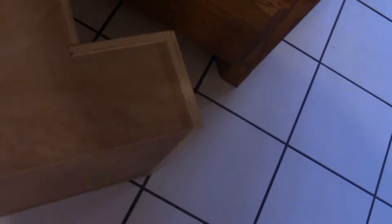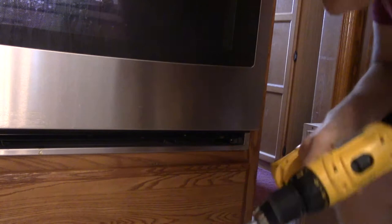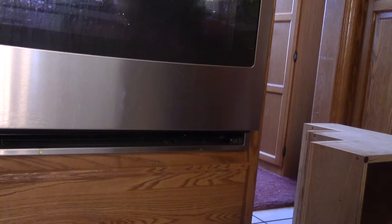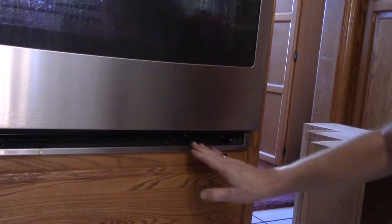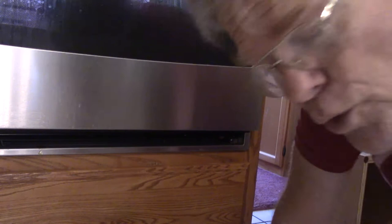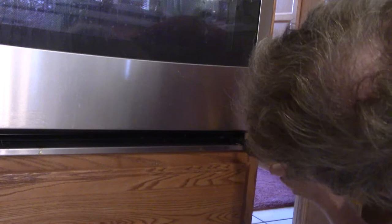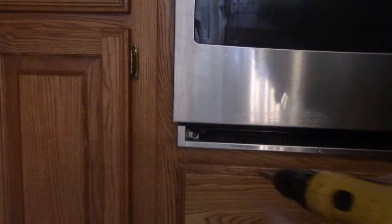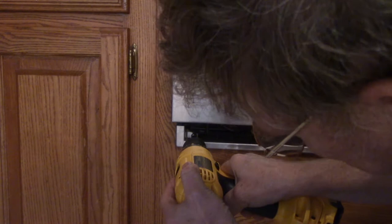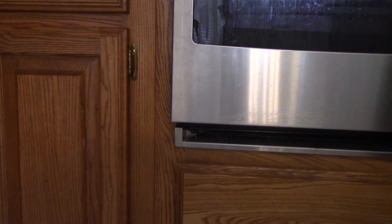The first thing we're going to do is take these two screws out and remove the bottom trim. I've taken the installation documents and I'm basically reversing the steps, starting with getting this bottom trim out. The instructions make a special point that if you don't take this bottom trim out first and you pull the oven out, you'll create some superficial damage to the oven exterior. Screw number one, screw number two — and that removes the bottom trim. We'll set that aside.